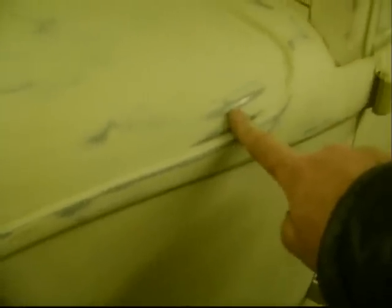This was the original. We had the DP sealer after the body work was done, then we put the catalyzed primer surfacer, and that's what's being sanded now. It's just about done. We don't care if we can see through it because it's going to get another coat of sealer — only reduced — and that's going to go on just before the color.